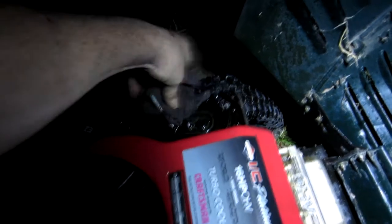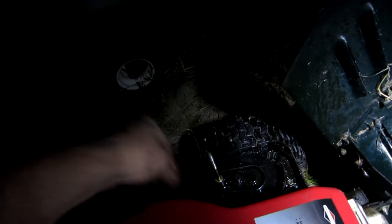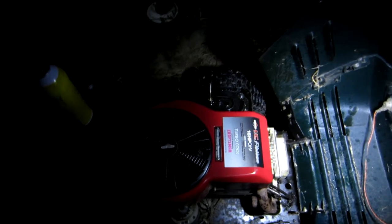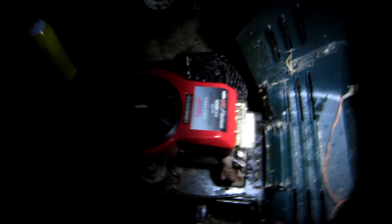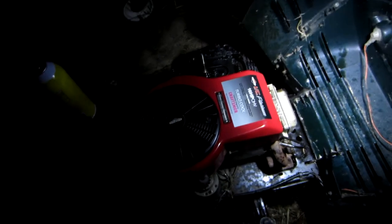Get all this sopped up out of this tray. What I think happened — I didn't have any regular gas, kind of out of money at the moment, and I did happen to have a can with some two-cycle in it. Just to get the thing to start before I found my can of starting fluid, I tried shooting a little bit of two-cycle gas down there just to see if I could get it to crank up. But long and short of it is I think that seat switch was the issue, because as you heard it did crank up and ran pretty strong.